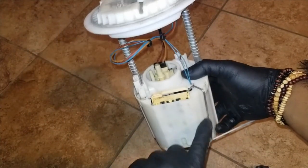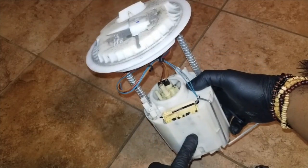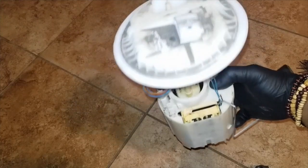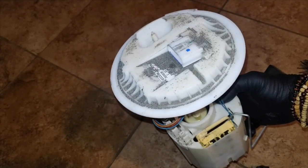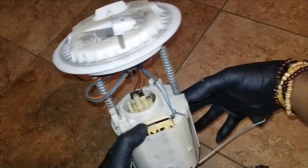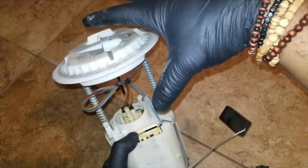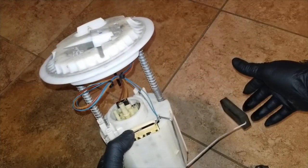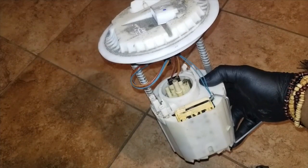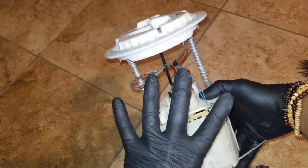The most common reason is that the little electronic contacts inside the pump itself get damaged, and the only option is to replace the fuel pump. I'm going to show you how to diagnose this. There are two halves — this is the fuel pump side, the other side is the filter, but they both have floats, so it registers half and half. Any of these components can go bad.